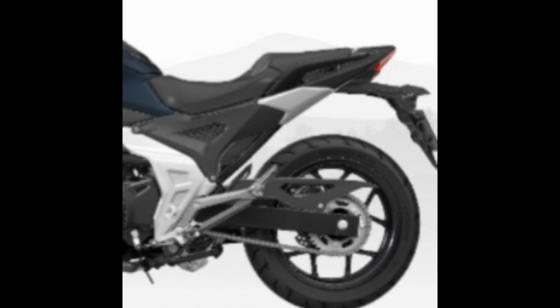So with a 14-litre tank, that means there's about four and a bit litres left, which is about a UK gallon. And based upon my fuel consumption, that would give me another 70 odd miles. I don't think I would push it to that level, but it's good to know that you've got plenty of miles left to go and find some fuel should you need to. It's given me a little bit more confidence. If I was on the reserve, I wouldn't be panicking and starting to look for a fuel station. I would just pick one up that was normally on my route.